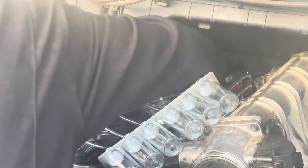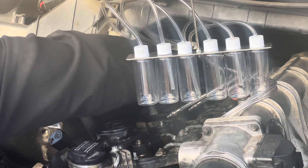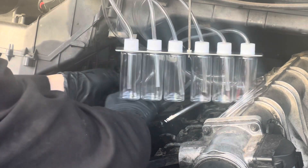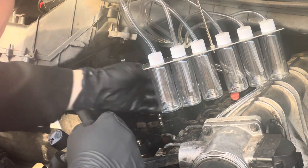As you can see I have a slightly different system than last time. Last time I had these little pipes sticking up that I thought would be convenient — you could just stick them into the injectors — but they filled up very quickly and I was not able to get any proper readings, so I consider that a fail. Now I have six bottles here and I'm going to organize this and then show you what I'm working with. This video is going to be nothing but the leak-off test.